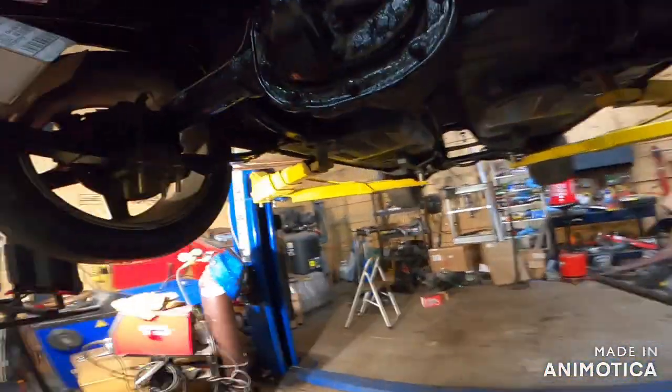Plan your brake lines accordingly so you don't have to splice anything. All of these are solid brake lines — one whole piece from there all the way up front. I've got them into the factory holders in the frame underneath, in the factory positions. You're going to have to get your measurements somewhat close so you don't have all these kinks and chinks. I ran it longer than what I needed so I could cut it and do the line right at the rubber line. All the brakes work — they're all bled. It can't move unless you push it, but it stops on a dime. It's amazing.